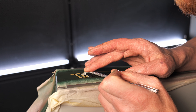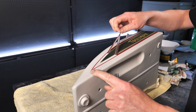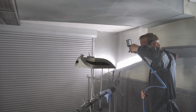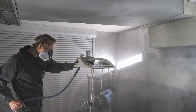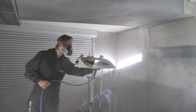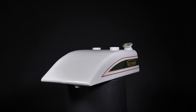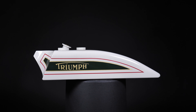I'm ready for some airbrushing. The tank is masked and I've pre-mixed all the colors needed for the graphics. Now I can fill one of my airbrushes and start spraying the outlines. Historically this is done with pin striping, but this time we use the airbrush technique and spray all the colors. I'm using an airbrush with a 0.5 needle-nozzle combination, which is perfect for filling backgrounds and spraying lines. The color is water-based, producing super thin coatings to avoid gaps between the color and the clear coat applied later. I spray areas, then mask with tape, then spray the next color — red first, then gold, then the Triumph lettering, which I mask before spraying the green. Removing the masking tape reveals the golden lettering.